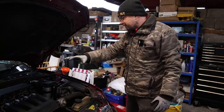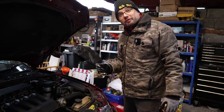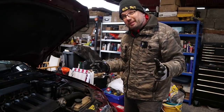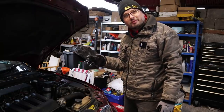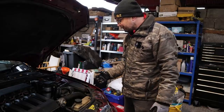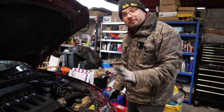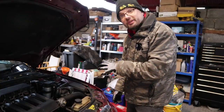The PCV is another valve somewhere on the top of the engine, and I do have a new one sitting in a box somewhere - same as the Freelander. It's also a good idea to go through the entire intake system, get the inlet manifold off, clean everything up as much as possible. I'm curious to see what state the EGR is in. The lack of power has come back - the turbo isn't kicking in like it was the other day. They can get so choked up they restrict airflow to almost nothing, or it could be vanes sticking on the turbocharger. I didn't even know we had variable vane technology on the turbo.